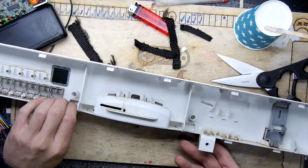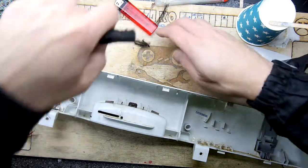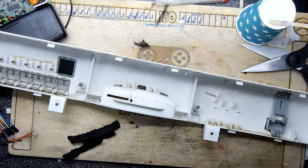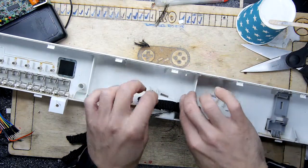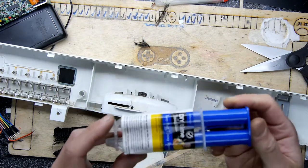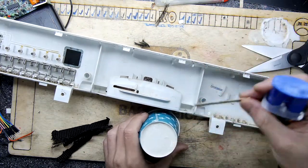So let's have a go at the reinforcing part. We've got some of those strips again. Now I've got an option. I could use the liquidy resin, which is more like the sort of car resin. So you'd mix that in a pot and then you'd dip this in like eggy bread and then stick it in. But let's have a go using just regular 5 minute resin that you'll buy in Poundland. This is the Tommy Walsh DIY Time brand.